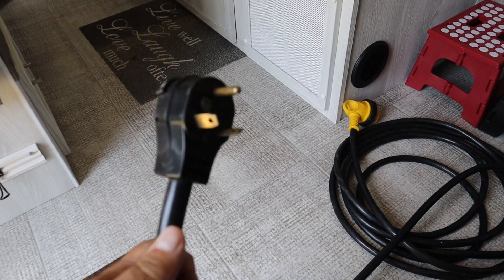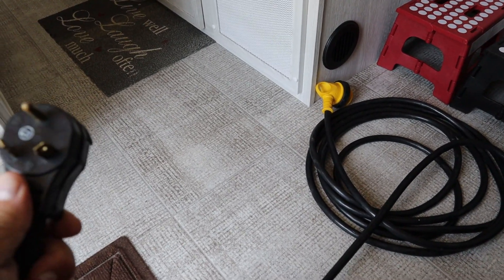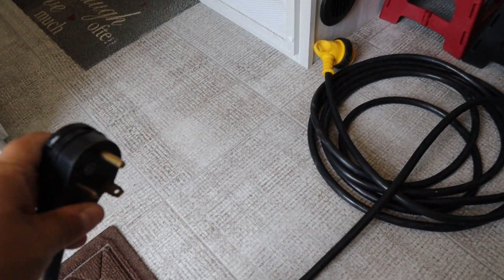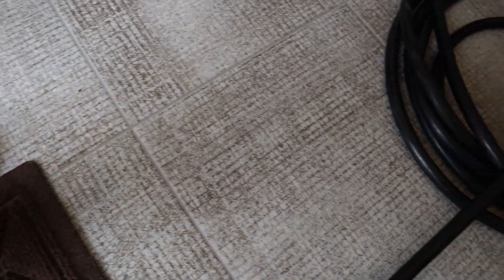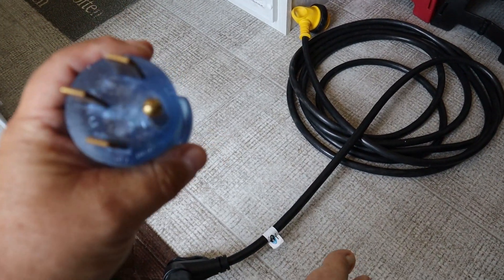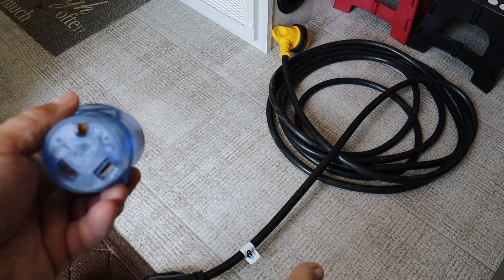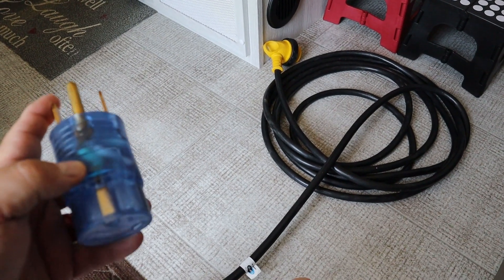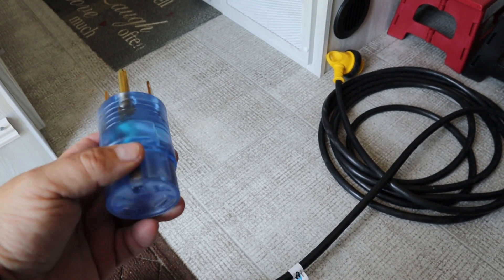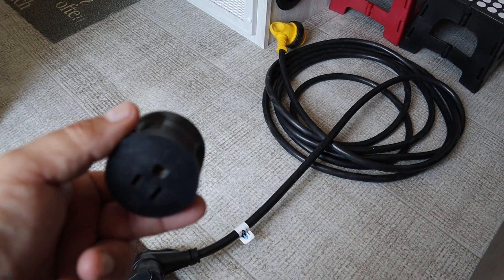On the GeoPro and ePro the system is primarily a 30-amp system, and this is the kind of plug you'll have for that. If you don't have this hookup available, you have different options. You go into your box and you have a strange-looking plug — then you can get this adapter, which is a 50-amp to 30-amp adapter. That lets you plug your 30-amp cord into the 50-amp setup and you'll still have plenty of juice to power things up.